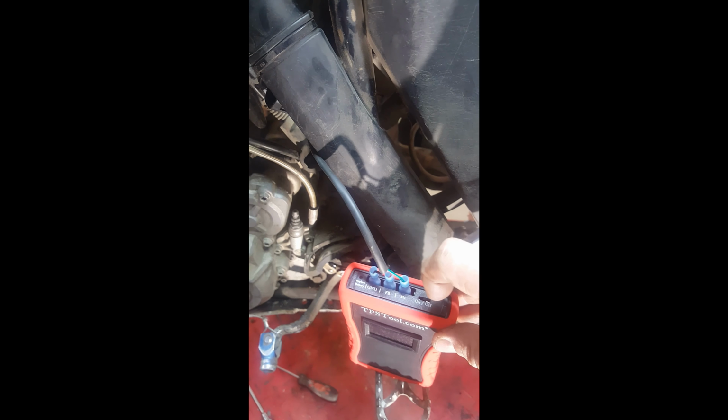So that's it. Next thing, just turn off the unit, unplug the pigtail from your TPS, plug the wire from your bike back into your TPS, get the boot on, and okay, actually I think getting the boot on was probably the hardest. That's harder than taking it off, but so that's it. It's done. All I got to do now is get this stupid boot on, and you can see this is not hard at all. It's not.